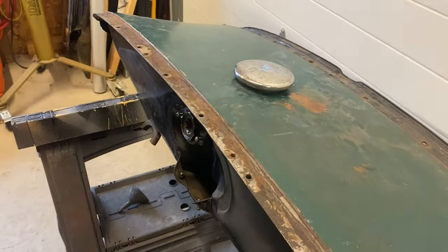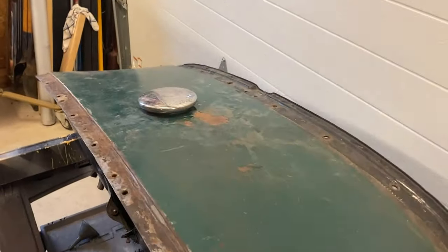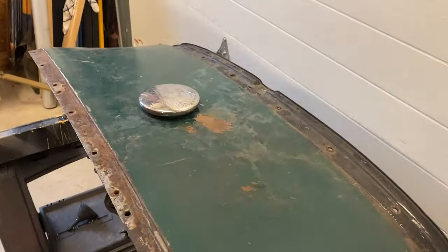Once we poured the entire bottle of metal prep into the tank, we rolled the tank around to coat all of its surfaces. To allow it to work, we placed the tank in different positions every half hour or so until the entire inside of the tank had been treated. Already changing colors. Sure is. A lot of suds on top.